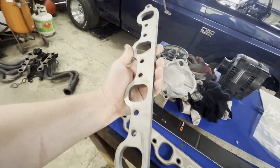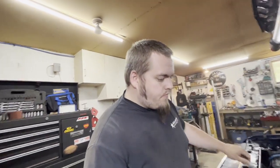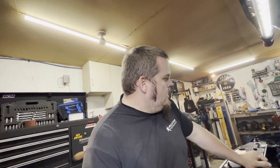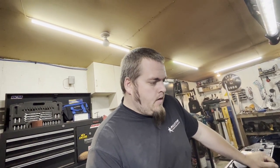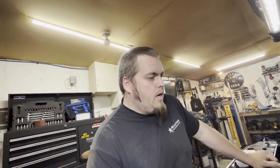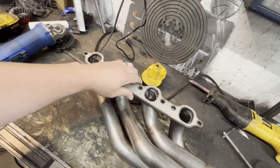I got my flanges cut — pretty lucky, these are the same flanges I cut for those other guys. The only difference is these are out of stainless, those were out of mild steel. I wanted to keep everything stainless. I didn't cut these on my CNC; it's just a nicer job if you find a shop with a laser, and luckily I work at a place with a laser. I'd like to cut header flanges myself one day, but I don't have a lot of experience with stainless, let alone 3/8 material, so this was faster and easier. With a little work with the Sawzall I cut the old flanges off.